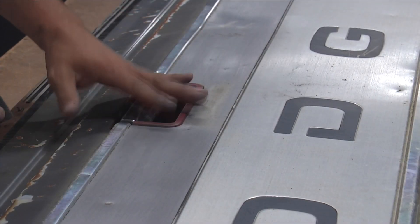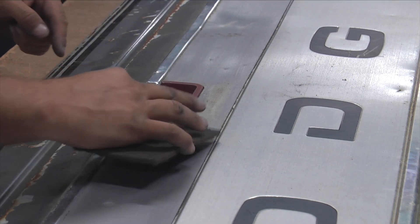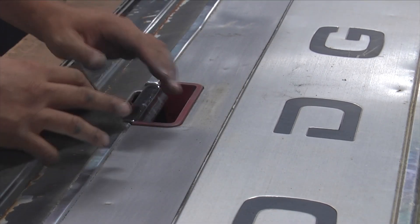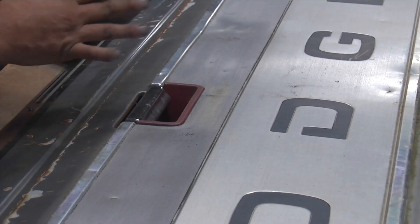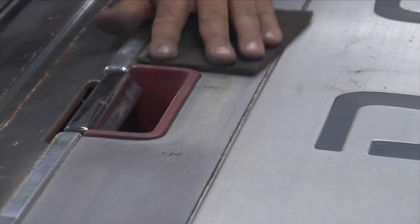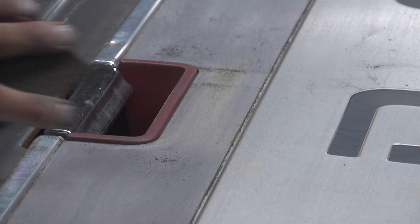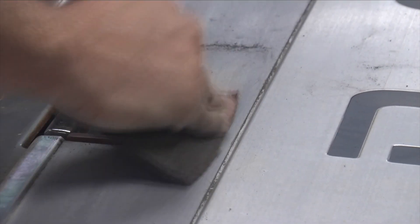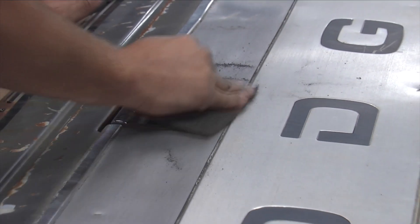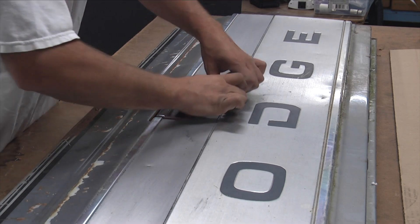The hardest part to clean is around the handle. If you do too much side-to-side action that will show, so you can do a little bit of side action to take off what's right on the edge, and then over the top do some back-and-forth motion to take out any light scratches from the left-right passes. Make sure you get underneath the handle lip. Any marks left from going left-to-right will show through your decal, so you definitely want to work those out correctly. This panel has had a tough life, but it makes a great demonstration of what can be done.